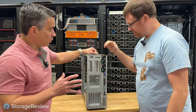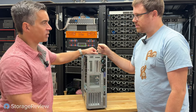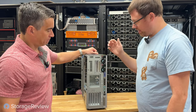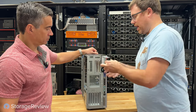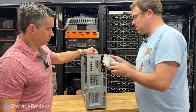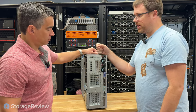Around the back, we've got a couple of typical server features like twin redundant power supplies. These go up to 2,000 watts — the ones in here right now are 1,000W — but depending on your configuration, if you have this completely loaded with GPUs you'll probably want the higher-wattage option. These support 120V and 240V, so you can use them in more environments. As you go towards the very high-powered configurations, you're probably going to want 200V and up.